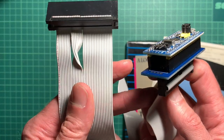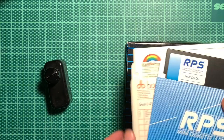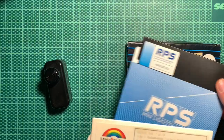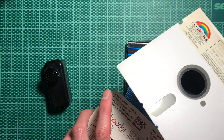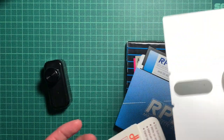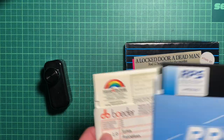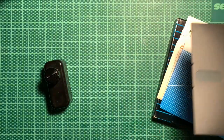Let's talk a bit about the C64 situation. I have two C64 discs — one that I wrote myself via an X1541 cable on the PC, which works fine, and I also have an original GEOS 2.0 disc which has some bad sectors. You can already see this disc has some damage. We'll see if we can get anything off it, which is actually one of the main use cases for this device. The C64 uses a single-sided floppy drive, so only one side of the floppy will be used.